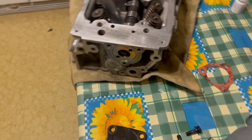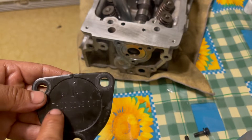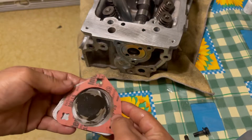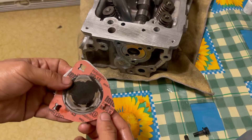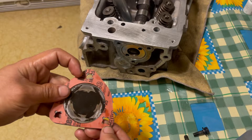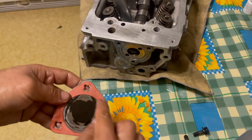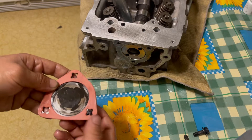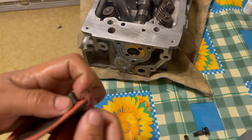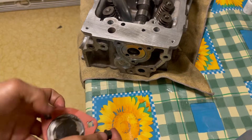As you can see, the gasket has writing that says 'this side is out' with an arrow facing up — that's how it's oriented. You have to line the gasket up with the holes in the back; it only fits correctly one way. It doesn't really matter if you flip it, but it's best to put the clean face toward the cylinder head. Slide the bolts in and try threading them by hand. Be careful not to break the gasket.